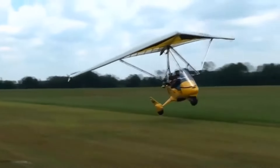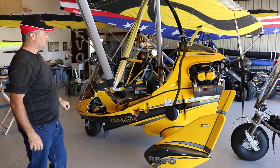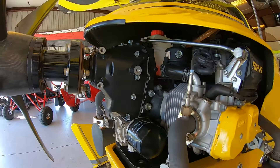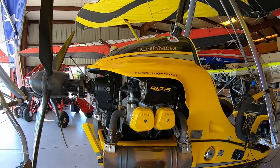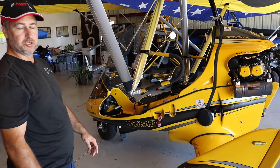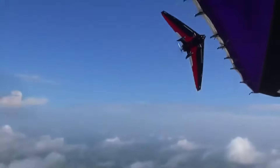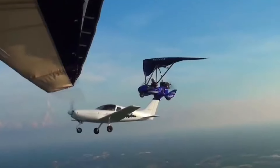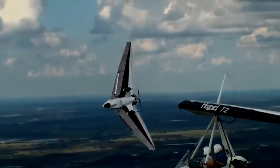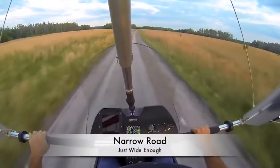We've got a 100-mile-per-hour cruise with it. You've got synthetic vision, touchscreen EFIS, all color with moving map. We offer the fuel-injected 912 IS on this machine as an option — it comes standard with 100 horsepower, but this is the fuel-injected version. This machine has a speed trim and roll trim, which means you can really trim it up at whatever speed you want to fly at. If you're above the clouds where it's pretty much always smooth, you can put your hands in your lap and go for a ride. I've gone over a half hour without having to touch the controls on a long cross-country flight.